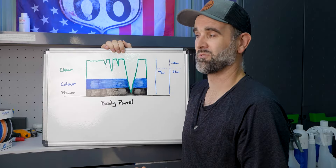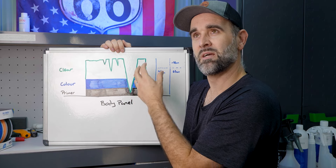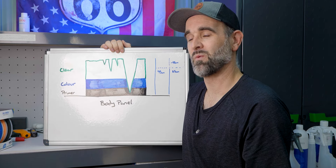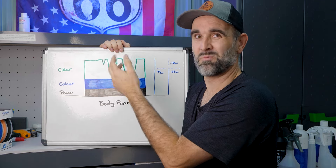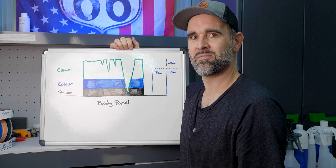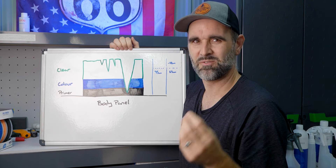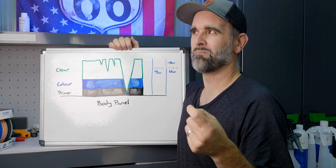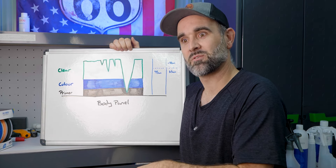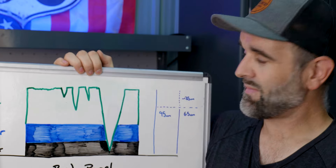The reason a scratch shows up - this deeper scratch here is an example going all the way through to the primer and maybe even down to the body panel. Your fingernail will typically catch these. Usually you can't do a great deal, but we can try to wet sand them out. What happens is light comes in and essentially bounces around - it just looks white, which is why you get white scratches on your car. But you can lessen the effect by rounding over the edges, which takes your eye away from them. Sometimes you can try to get rid of a scratch but never 100% remove it - the average person may not see it but the owner, if they looked, could just about find it.